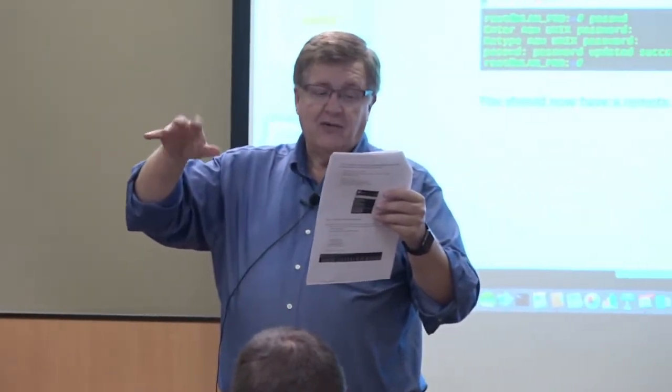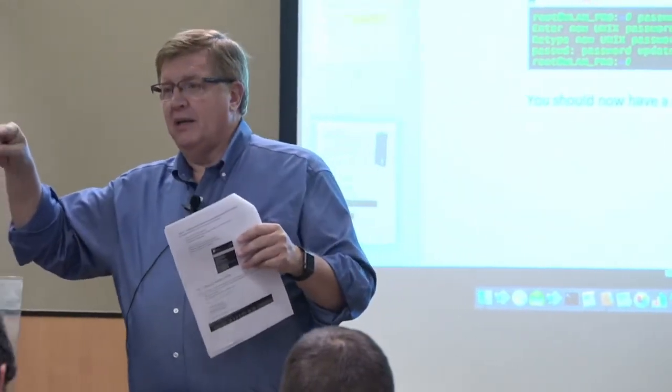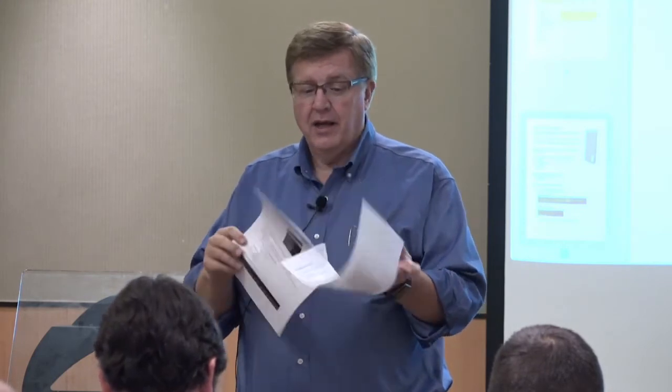Eight is now using a browser. Everyone can use the browser. If you hit this Odroid's IP address from a browser, you will get a speed test. We've added six others. If you don't like the way one looks, try another one. For additional tests, hit the web, the IP address, /example1, example2, example3, example4, and you'll see what the other options are. These are the easiest for your end users because they're used to seeing speedtest.net, but this one, unlike speedtest.net, is actually testing the real wireless, not the whole internet.